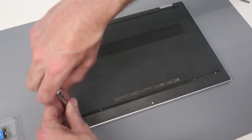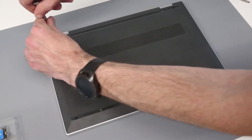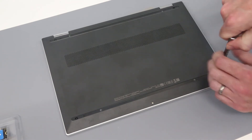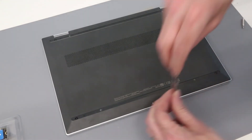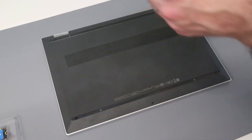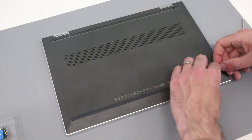Obviously, onto the SSD we have cloned the original Windows install. Alternatively, you can do a fresh install of Windows onto the new drive. With this done, just swap into the smaller screwdriver bit one more time for the front screw. This just leaves us to refit the rubber strips to the base — these have little keying positions, so we should be able to locate those and place them back onto the base of the machine.